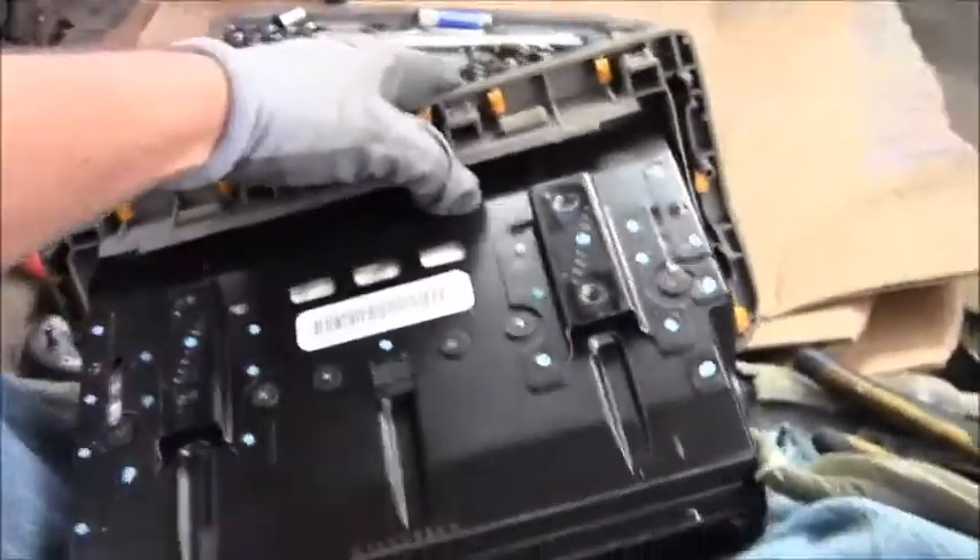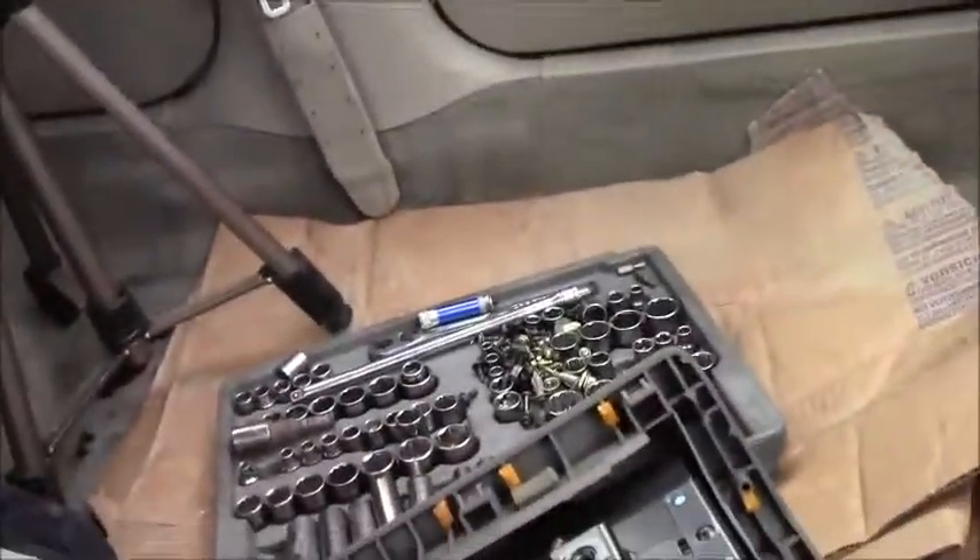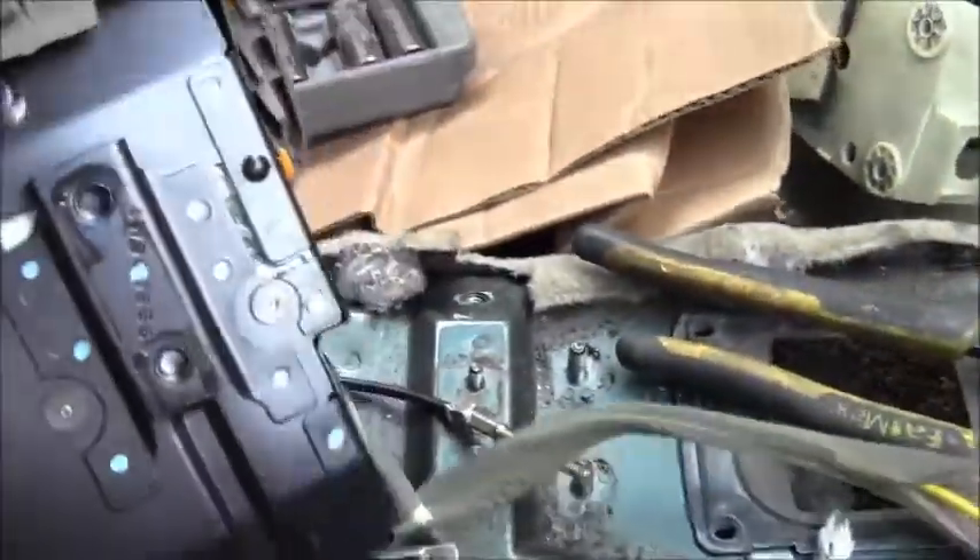Pull the little tab things out that are stuck in there — once you get those all pulled out, there's another one. Really had to watch out for that yellow cord. Here's the airbag in all its glory — the passenger airbag. I took the seat out to make it easier. There are a couple more electrical connections to take off, and here you go — one passenger airbag.